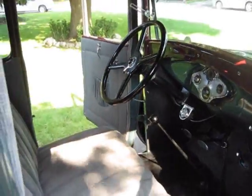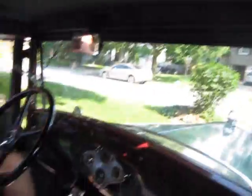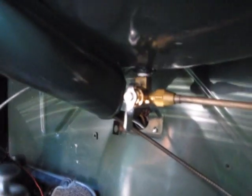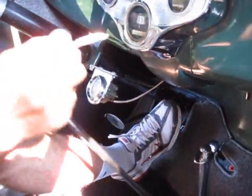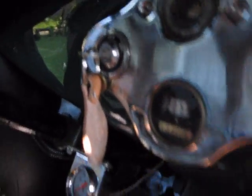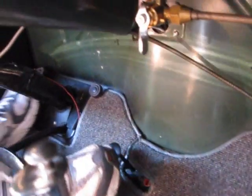We're going to the antique car show. We're going to start the car. You see this switch underneath here? The first thing we do is turn that on. Then we turn the choke clockwise all the way. Now we get the car in neutral, make sure the emergency brake's off, and put the key in the ignition to the on position. And then down here, that little button is our starter button.